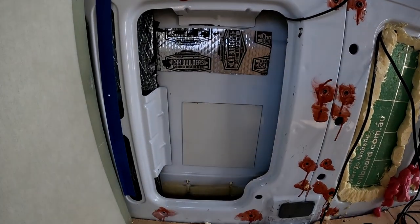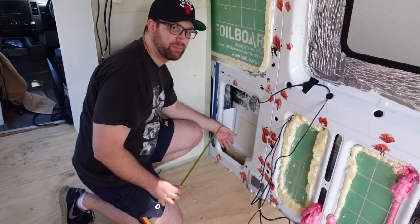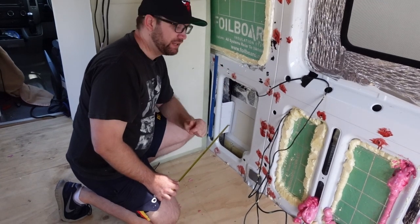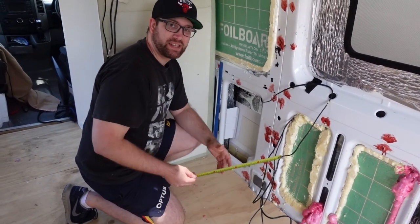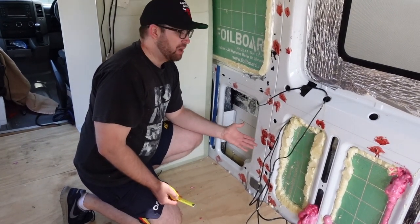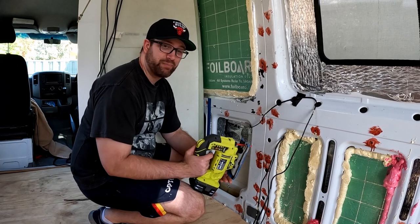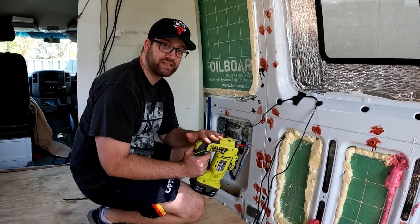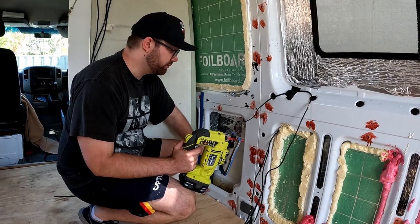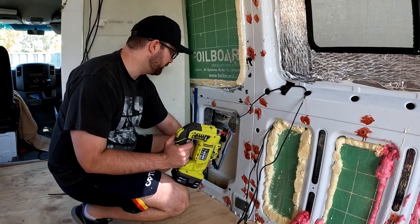We're going to be putting the hot water system in here — it's going to fit essentially just on the edge across to about here. I'm going to have to jigsaw some of this out and get the grinder to cut the base. You want it flush with the floor so it has a good connection with the ground and doesn't jump up and wiggle out of the spot. With these gas hot water systems they have screws too, so we're going to put a backing on it to hold it into the van so it doesn't shake loose when we're driving. I'll use the jigsaw as much as possible, then come in with the grinder for the bottom bit. None of this is structural — you don't want to be cutting into the actual cross members that support the van structure, but all these little bits here are fine.